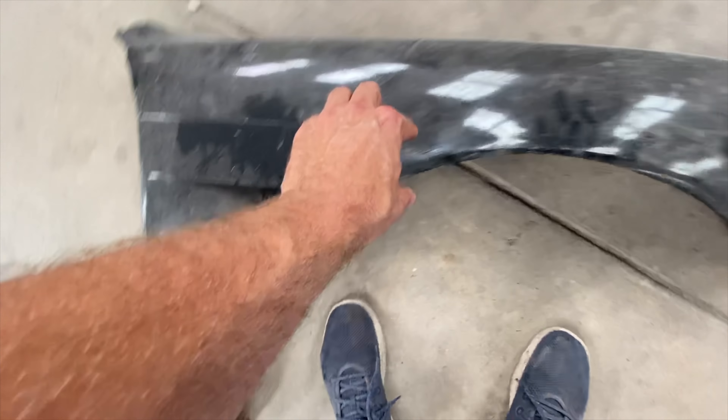We've also clearanced up here slightly. Fenders, when they come to you, they have a lip on them. The rears are always especially bad. As your tire cycles up it catches that, and in the back it's really bad. So when you get a normal fender, this is a wheel well — if you put this on your car like this, you're immediately going to have the tire crash into this surface. So I cut that off. Pretty much all drifters cut that off. You just cut it through there and make it like a two-dimensional fender, which is what we've done back here. Because if that went across there, there's no way you could have wheel fitment like that.